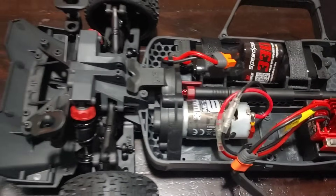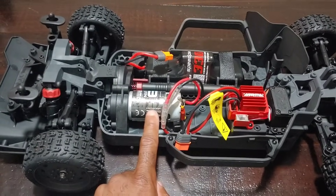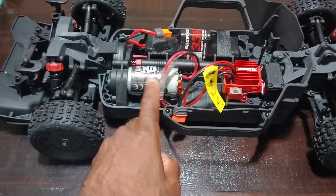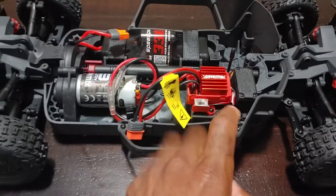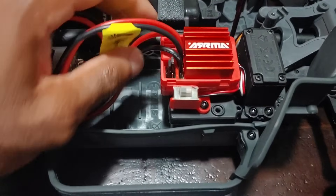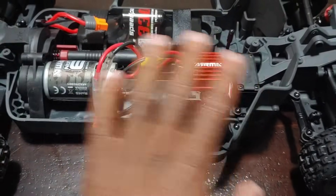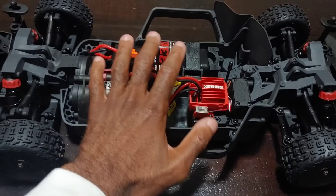Taking the body off, you can see the meat on the inside. As I mentioned, this is a 9-turn brushed motor — I have never in all my years in RC heard of anyone doing a 9-turn brushed motor, so this is going to be interesting. I'm going to run it completely stock out of the box tonight and let the motor break in. The ESC is 2S only; I'm going to run on NiMH and then do a brushless conversion at some point. For lipo use, they have jumpers on the ESC, and I believe the default setting if you lose those jumpers is lipo.